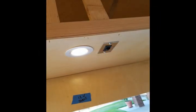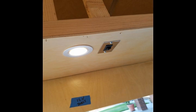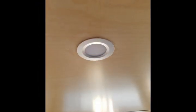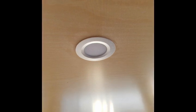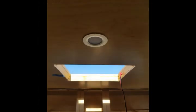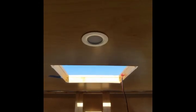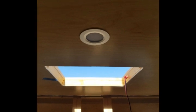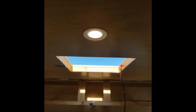This one is over the kitchen table. This light — not quite sure exactly where it is — could be either in the galley, the entryway, or towards the front over the gaucho. That's what the lights look like off. They're real easy to install: you just cut a hole, drop your wire, make your connection, and these have little retention springs that hold it in nice and tight — they're not going to fall down. This one towards the front is right next to the vent, which has a 12-volt line coming out for the fan that I'll be installing.